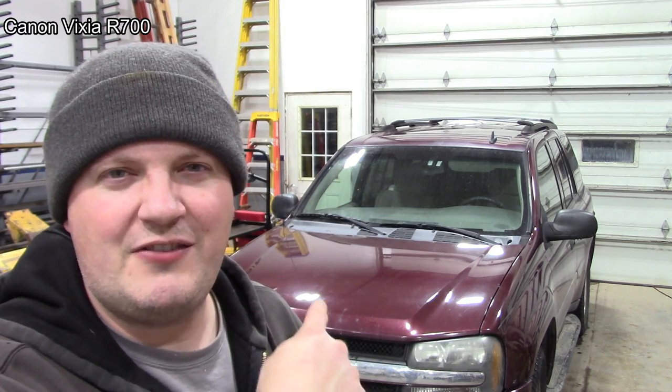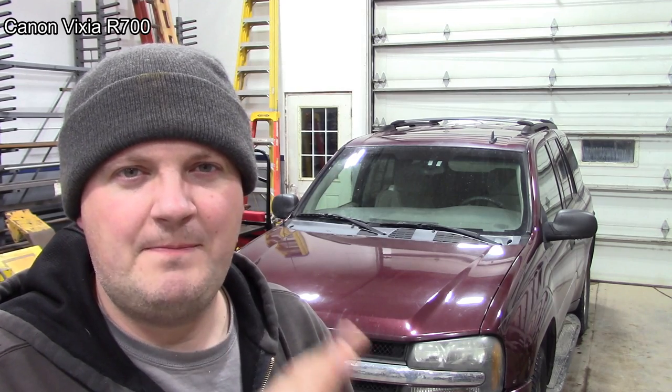I don't think I filmed an intro for this video, so I'm retroactively filming it. This is a 2007 Chevy Trailblazer. It's got the 4.2 liter straight six engine. The complaint is that it runs rough when they cold start it in the morning. Sometimes it'll actually die. But he said if you give it some gas, it'll usually stay running and pretty quickly it clears up and then it runs fine for the rest of the day.